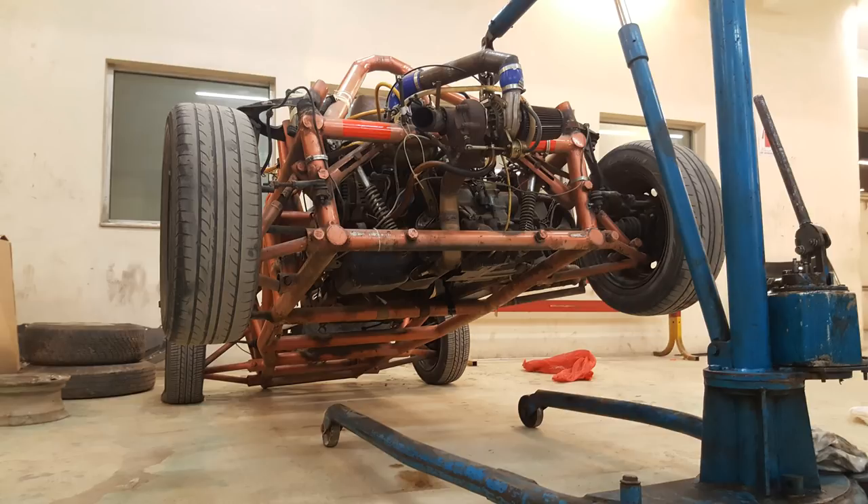Once most of the transmission work was done, I had to put the turbo back in and connect the pipes, since the turbo had been taken off during the transmission work. I put a cone air filter on one side of the turbo and linked it to the engine. This time I kept it really safe at 4 psi. Last time I was actually surprised at how much abuse this engine took — I had the turbo boosted all the way up to 9 psi without an intercooler, because the intercooler radiator broke off in a crash and I never bothered replacing it.